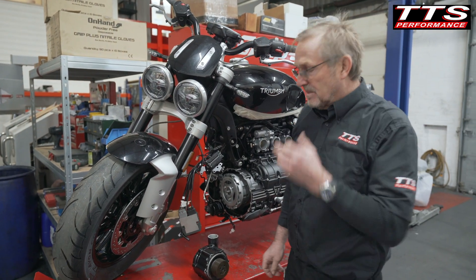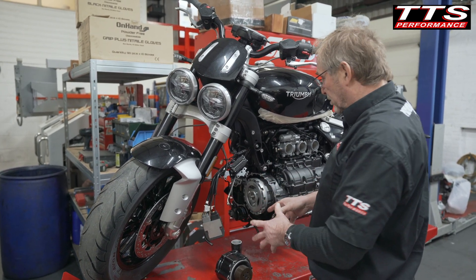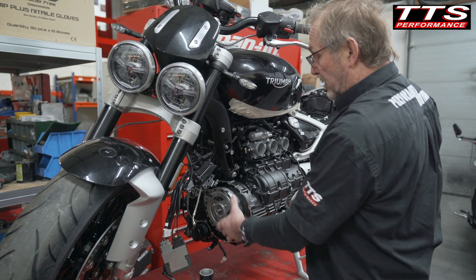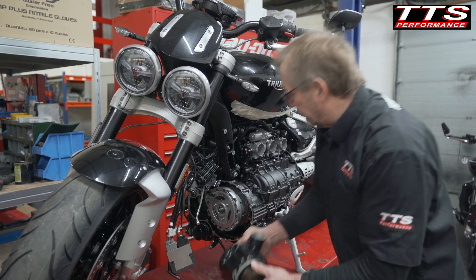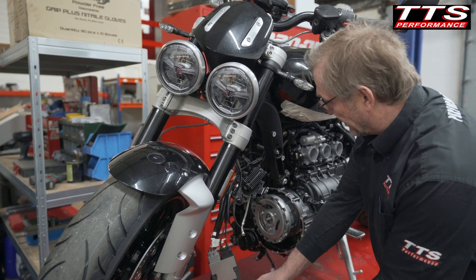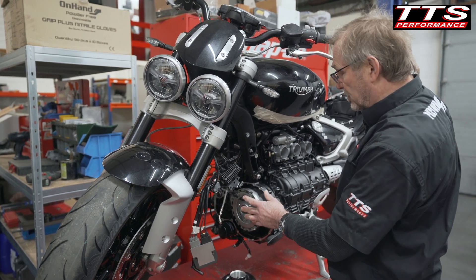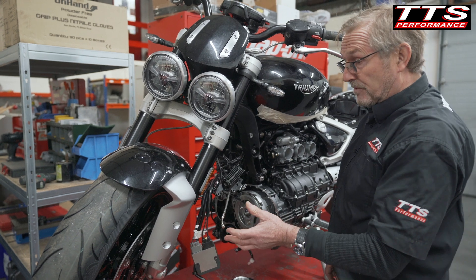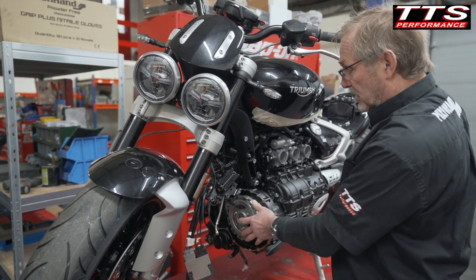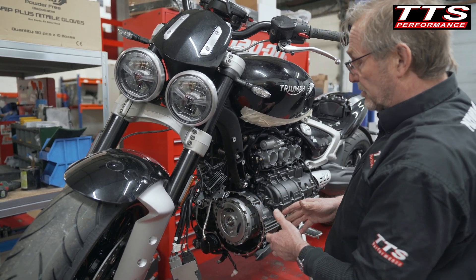About three days in, I had a eureka moment and realised there was a possibility of driving the supercharger off the clutch. The clutch rotates in the opposite direction to the crank, so it's rotating in the right direction for the supercharger. The supercharger could sit right there — a very simple drive. The question was how to get the drive off it, and whether the clutch rotates fast enough. The primary drive ratio turned out to be 80% of crank speed, which is acceptable. With a big pulley on the end of the clutch, we can achieve the ratio needed for the supercharger to do its job.